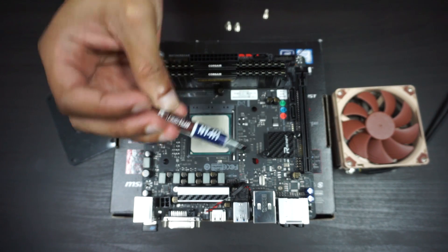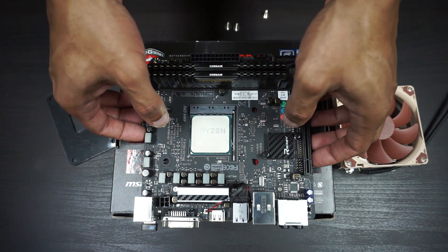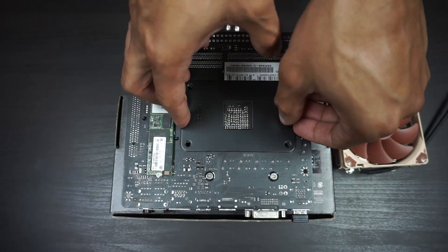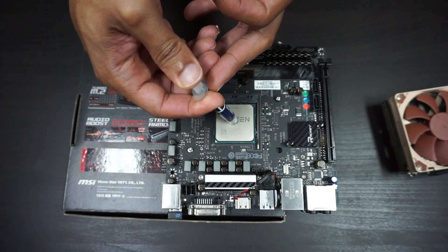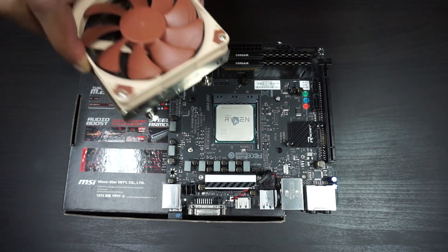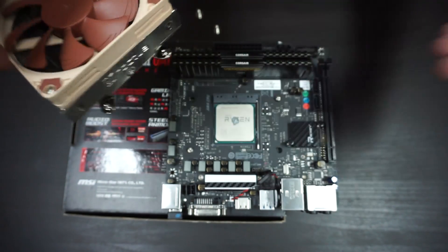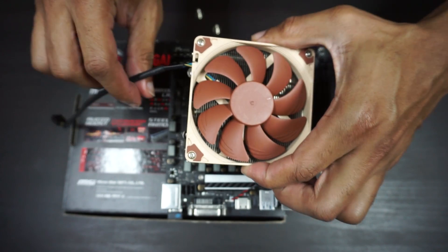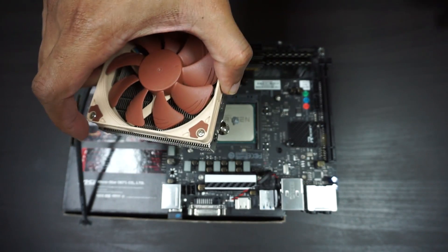You can't go wrong with the NT-H1. If you're looking for an upgrade from some mediocre thermal paste, you should check it out. I used a little more than I normally would on an Intel CPU because this is a larger CPU with more surface area, so hopefully that works out. One limitation with this cooler on the AM4 board is that you can only orient it two ways. The airflow really should be going diagonally, but you can only go this way or that because of the bracket position. I'll set the airflow direction going away from the RAM, so hopefully that should be okay.